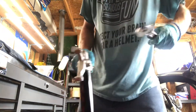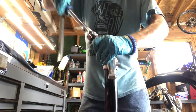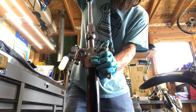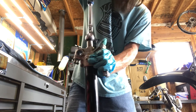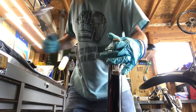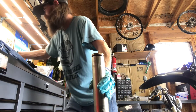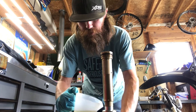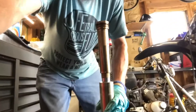Get the stopper out, stand back up, and then screw this all the way down — it's got a long ways to go. Just snug, and you'll finish it on the bike. For the fork oil, you can play between 330 and 380cc's, so I'm just going to use the standard 350cc. Slide this guy down so you can watch me pour the oil in.